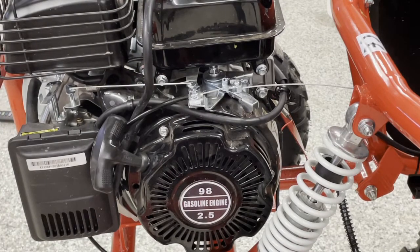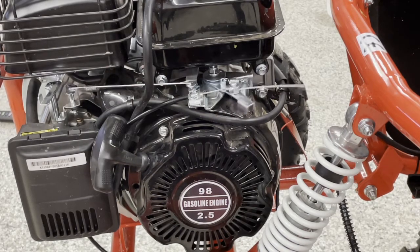So right now on this, my throttle cable is actually a little bit loose. I'm pressing on the accelerator here and you can see that it really doesn't move very much until I really give it gas. So let's tighten that up a bit.